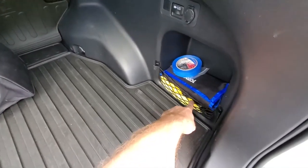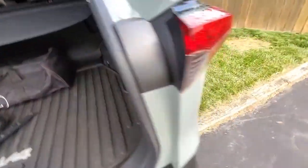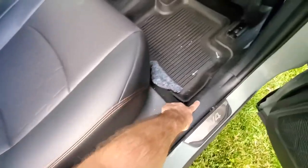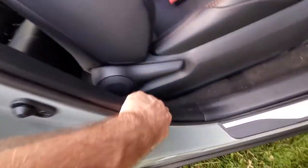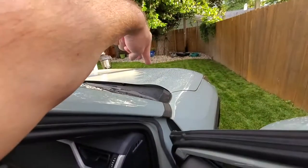If you have a hybrid, your battery is in the back. I recommend connecting a low gauge positive wire to the battery with an inline fuse and sending it to the engine by going under the door panels and through the firewall. After you have the positive wire in the engine, mount it on a bus bar so you can connect multiple interfaces without running any more wire. Make sure you fuse or get a circuit breaker.